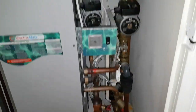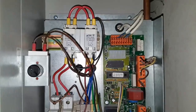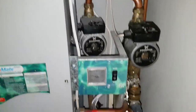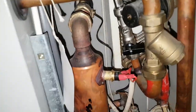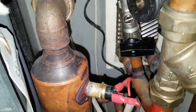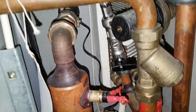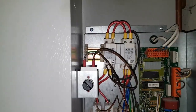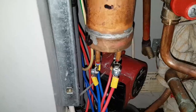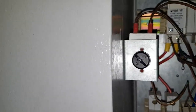We turned the power on and we had a faulty display on the PCB, which gives us suspicion that the board had gone. The second problem was on this heating element here — the overheat thermostat had tripped. So we reset it, then it sent power up to the relay. I checked back at the heating element down here to see if power was present, but there was none.